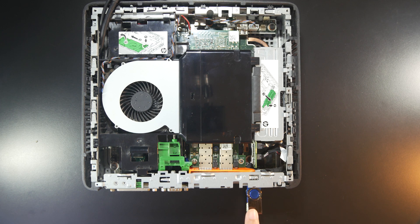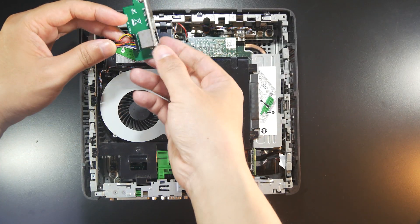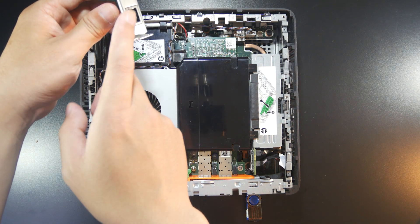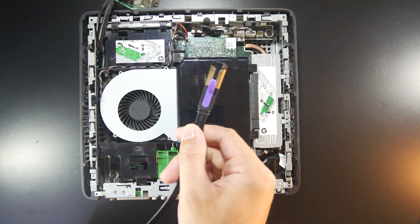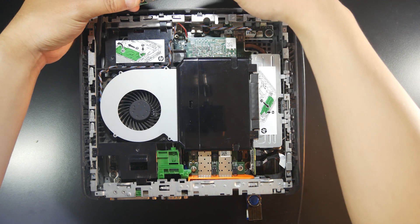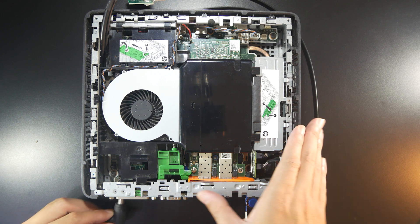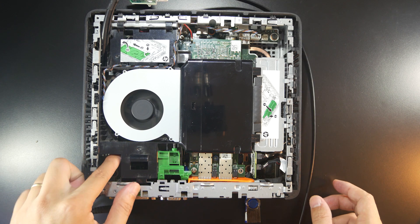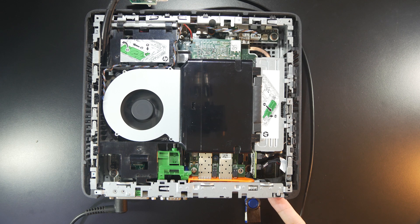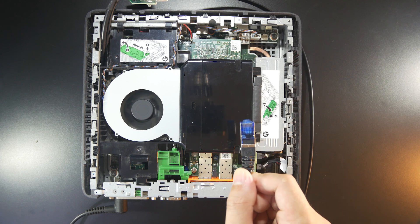For this video I use a USB drive to boot up OpenWRT. I have the onboard network adapter and a second network adapter — one will be the LAN port and the other will be the WAN port. Here is the network adapter connected to my PC. I assume this is the WAN port and I'm going to connect the cable from the upstream router to it to install some packages first.